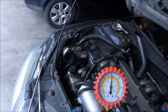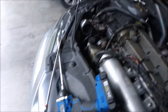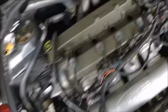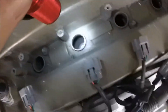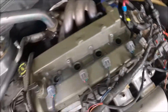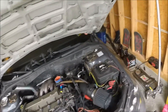It's now been about seven minutes and the gauge looks about right where it was, so we should be all right. Looking down in the cylinders — if coolant passes through the head gasket, the piston tops will be wet. That one looks dry, that one looks dry, that one looks dry, and that one looks dry too. Just some crud on top but no shininess. We should be good.